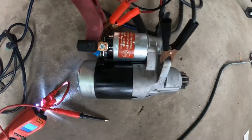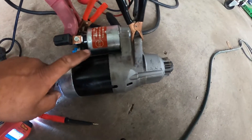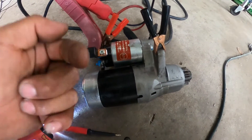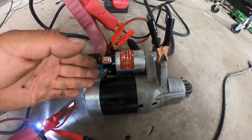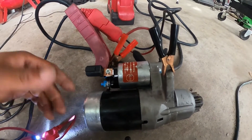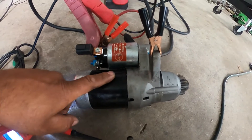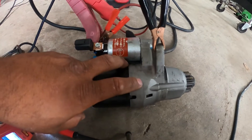So if you have a new starter — brand new, almost brand new — and it sounds like the engine is locked, you will hear a clicking noise on that video. So if you've got a brand new starter and it sounds like your engine locked up, you better do a double check. That's what we're doing right now, because this is a new starter and we believe the starter is bad.